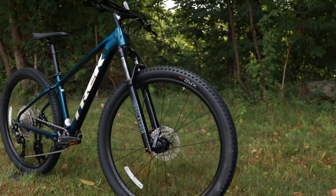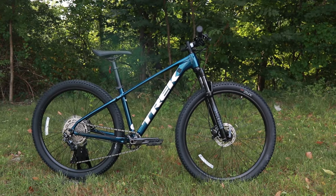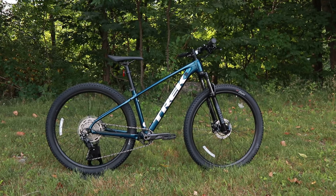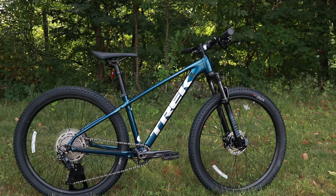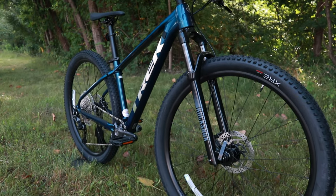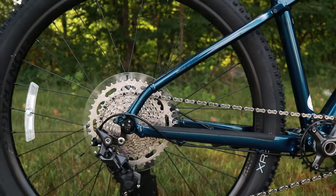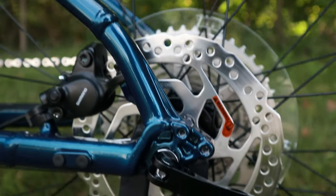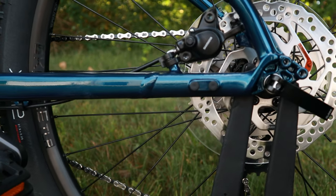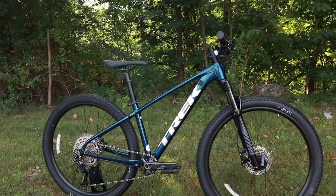If this were a medium or larger, it would come with a 29-inch wheel and that same XR2 in a 29 by 2.2. Smart Wheel Size allows Trek to give you the fastest wheel size that fits, and generally in an XC bike a larger wheel helps with performance. The bike is also internally cable routed, and even though it's a 1x, it does have a spot for a front derailleur mount. In the back there are mountings for racks, so you can add a rack or even a kickstand if you want a more adventure-oriented setup. Overall it's a really nice, versatile frame.